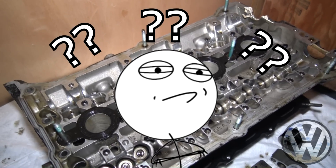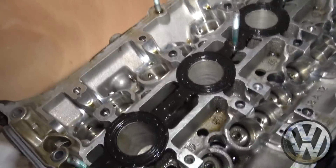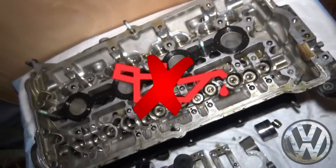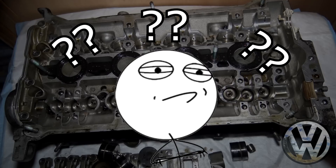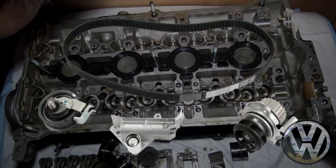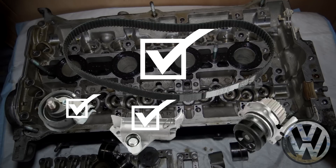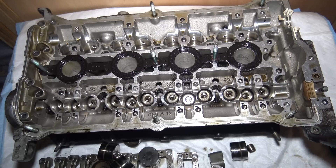I've looked at other possibilities for how this could have happened — low oil level or low oil pressure — but as you can see we got a lot of oil up at the head, so lubrication wasn't the cause. If lubrication was the issue, the intake side would have been trashed as well, but it's actually looking much better than the exhaust side. Another possibility would be the timing being off, whether it be a bad belt or something within the timing system, but there was no damage to the teeth on the belt or any of the components failing, and the valves are not bent. Anyway, that's my take on it. The parts for the head swap and turbo came in, so stay tuned for the next video. Mahalo guys for watching — see y'all in the next one.